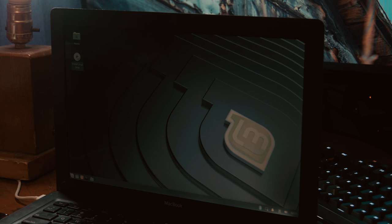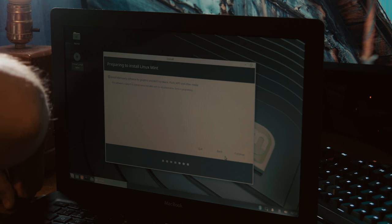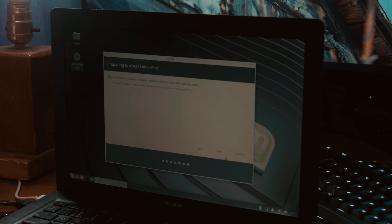Let's install Linux Mint. English. Let's install all the third-party stuff. Let's see if the WiFi works — no, WiFi is not working. So let's grab an Ethernet cable. Ethernet is plugged in, it is recognized, connection established. This is a blank drive so we're just going to erase everything and format the drive. We'll keep the EXT4 filesystem and pick our region.